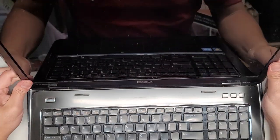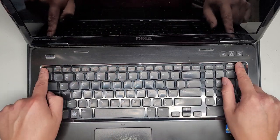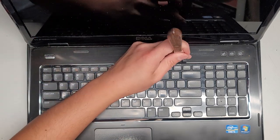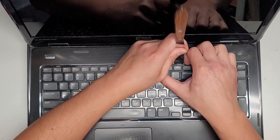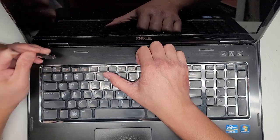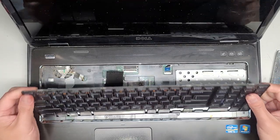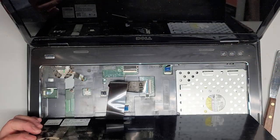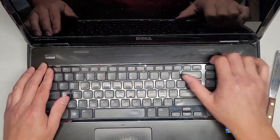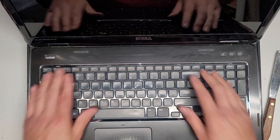We got the whole bezel back in. If you're wondering, the keyboard has a way to pop it out from here — you can see these little clips that hold it. You can pop that out without having to take the screws on the bottom out. But to get the hard drive and everything, you will have to pop this up. In here you can see inside and have access to the fan a little bit. If you need to take it completely apart to clean it or to get the hard drive out, you're gonna have to take all the screws out and then remove this whole palm rest assembly.